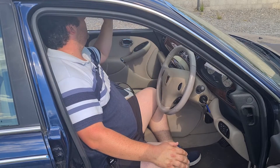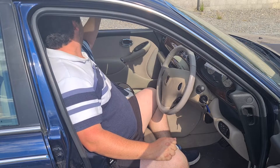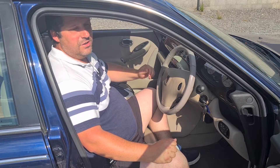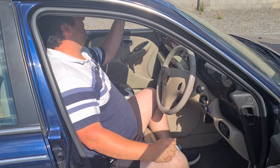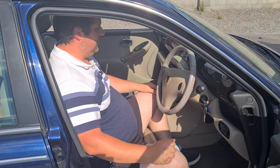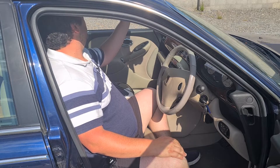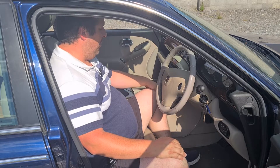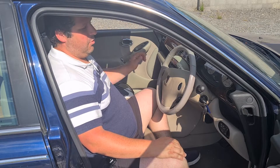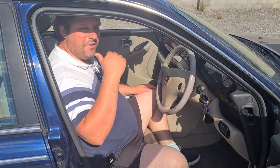I haven't operated the sunroof after what happened earlier in the week. There are little sunroof guide clips, and unfortunately the sunroof stuck. I thought nothing of it, got called in for tea, came back out and there was a lot of smoke emanating from around there. It didn't pop the fuse, but the motor stayed trying to actively shut the sunroof. Luckily I was only inside a minute and copped on. I've just disabled everything for pure safety. Looking it up online, those clips are only a couple of euros and apparently easy enough to swap out. I've tested the motor and it isn't burned out, which is superb news.